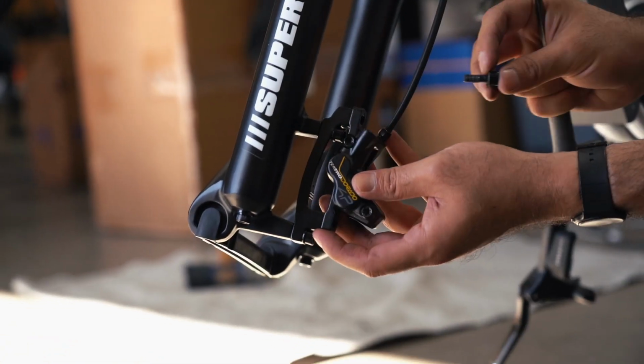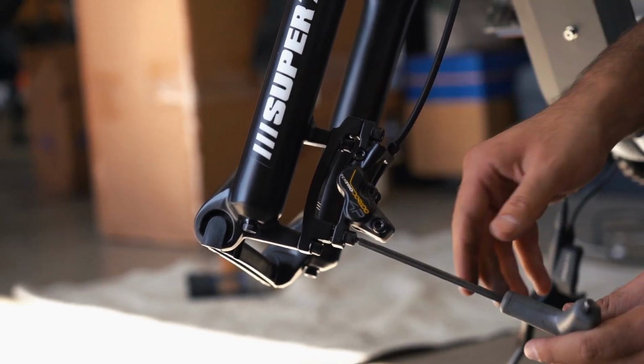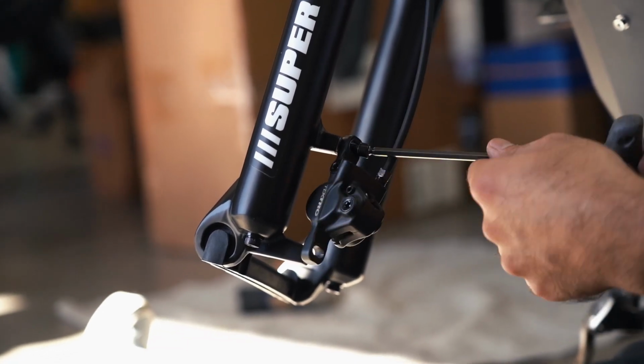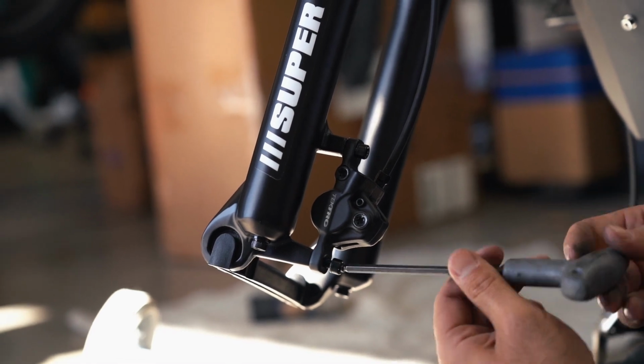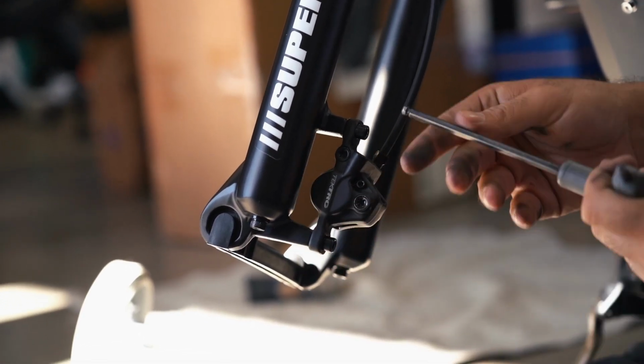Now you may attach the front brake caliper from the OG to the brake caliper bracket using a 5mm Allen wrench. For the Z series, use a 5mm Allen wrench to attach the front brake caliper to the fork at the caliper attachment without the brake caliper bracket. A brake caliper alignment will be necessary once the front wheel has been installed.